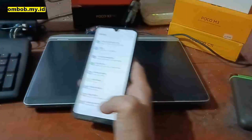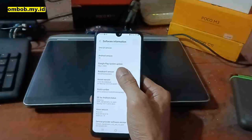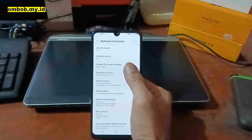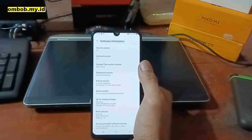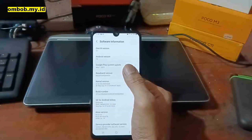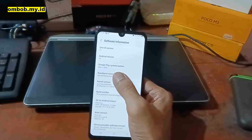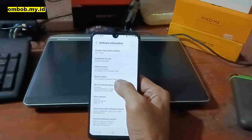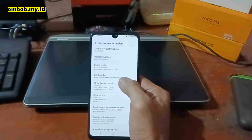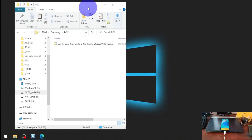Make sure you have the same firmware as the phone. If you don't have the same firmware you should download the right firmware. The build number is m325fxxs6 — this is binary 6, so you must have the same firmware.